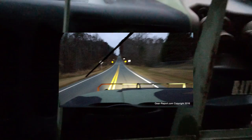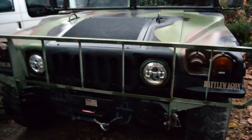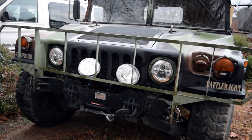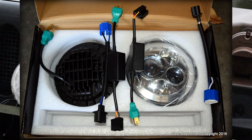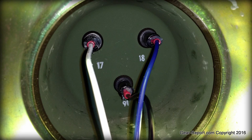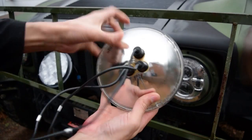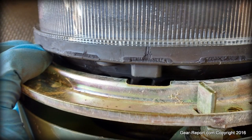I'm really enjoying them, and this is one of the most cost-effective upgrades I've found because it's just absolutely crazy what headlights cost for these things. These new headlights don't use the same kind of connector, so you have to modify the connector that goes on — it's as simple as putting the male end of a bullet connector. I use the red ones for that 14-gauge wire, and they slide right inside the connector on the other end that sits in the back of the housing. There are also raised areas on the back — one, two, three of them — that line up so it's aligned properly, so your cut line on the light is appropriate and you're not blinding people coming at you.